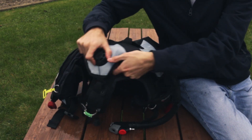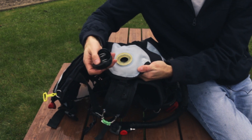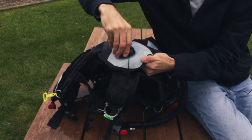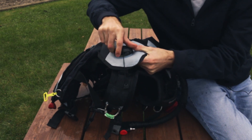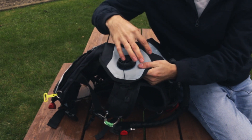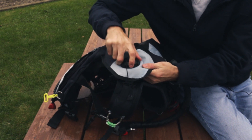When it comes to screwing and unscrewing these dump valves, just make sure you aren't cross-threading them. A good way to do that is once you've got everything lined up, instead of going righty-tighty right away, go lefty-loosey a little bit until you feel it catching on the thread, then slowly start to do the righty-tighty. If you're feeling any resistance, stop, back off, and make sure you're not cross-threading, then gently screw them back on until they're tight.